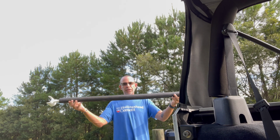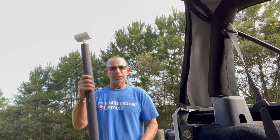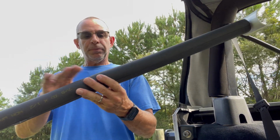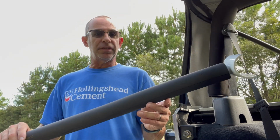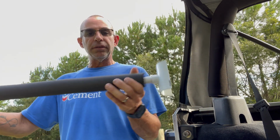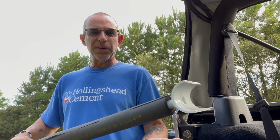So you're looking at 45 inches across, and then add your reducers. Put your insulation on, and that way the roof isn't hitting the PVC pipe. It helps deaden it. Now, if you want, at this point, once you have it all sized and everything's good, take it back apart and go ahead and spray your white ends here. Go ahead and spray them black if you want, or gray, or whatever color your interior is, so it doesn't show out, you know what I mean?